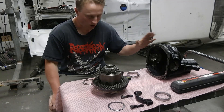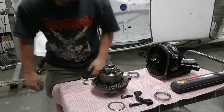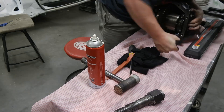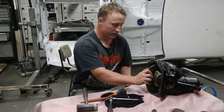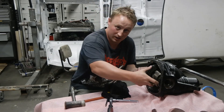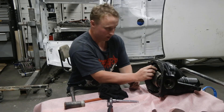Next I'm going to try and put it all back together. I've paid attention to where all the parts came from and I'm going to put them back in the same place. I'm going to tension the bearing caps to about 90 foot-pounds, and then hopefully I'll be able to check it and see if everything's right. I had a lot of trouble getting this centre back in, especially the shims. What did work was just sliding the whole assembly in with all the shims in place, tapping it with a nylon hammer to work it in and pulling the rest in with the caps. Doesn't feel like it's binding, so I guess that's okay. Next I think we're going to put some grease on here and check to see if the engagement's right, and also check the lash with the dial indicator.